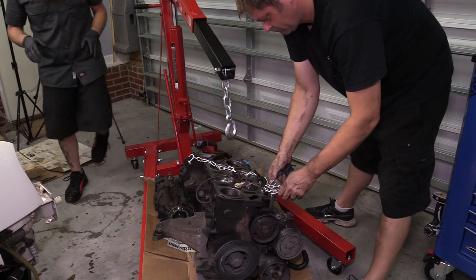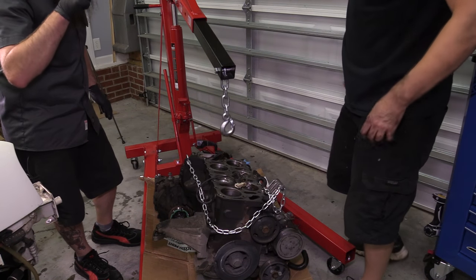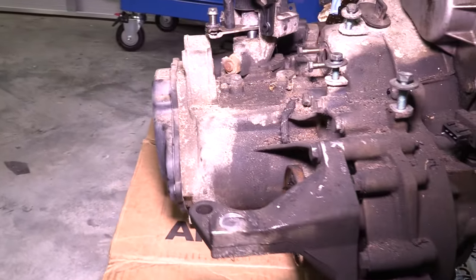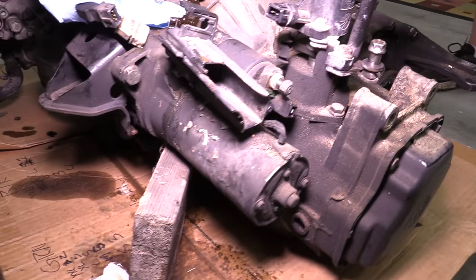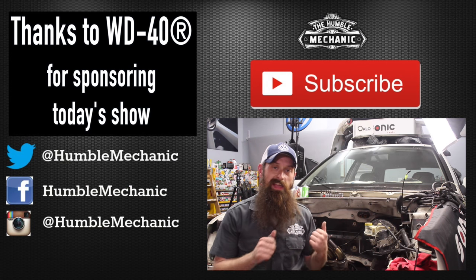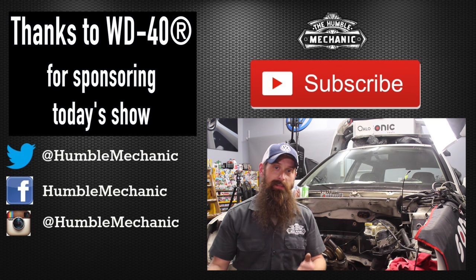One thing you want to be careful of if you're doing something like this: be careful setting it down right on the oil pan. One, this is a steel pan so it's going to support a lot of weight. Two, we have a lot of things already off the engine — we've probably cut over a hundred pounds off of this as it sits. And three, I'm going to be pulling the pan anyway. So I'm going to do an inspection to make sure that by setting it down we didn't mess anything up. Typically I set it down on a block of wood — and it's sitting on a giant block of wood, so we should have no problems with any damage to the bottom end. There you have it — the engine and transmission are out of the car. Now we can put the engine on the stand, separate the transmission, inspect the clutch, do our lower chains, get our head put back on, and get the car back together.